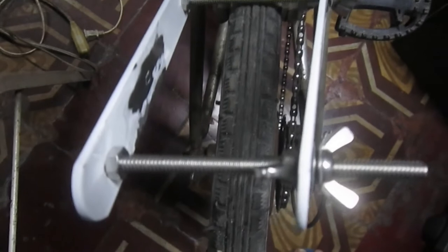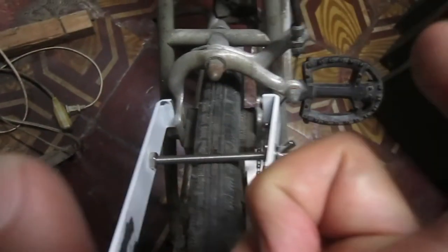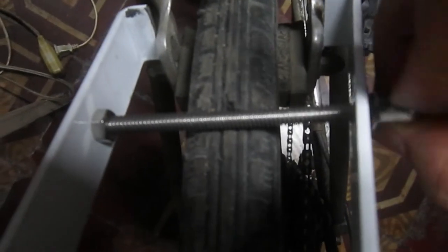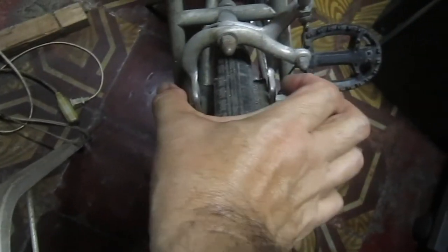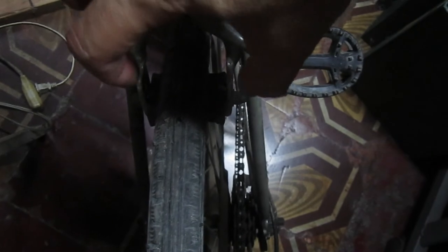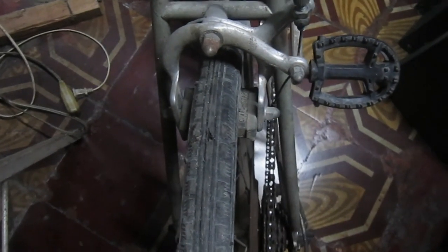This is the bicycle third-hand which I invented — you can easily copy it. This is an ordinary piece of bracket with a clamping mechanism. If you want to remove it, just turn this. To place it, put these two ends on the brake and tighten it — as you tighten it, the calipers will meet the left side and right side of the bicycle rim so you can easily adjust your brakes. You can also use this on V-brakes.